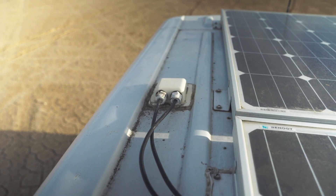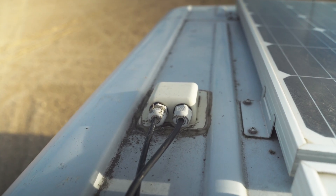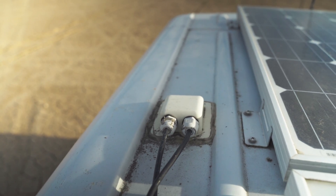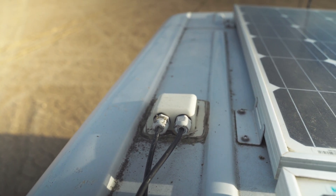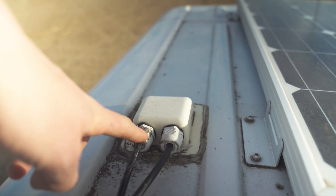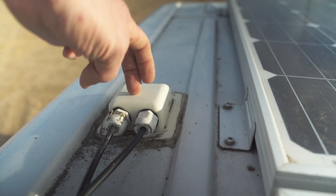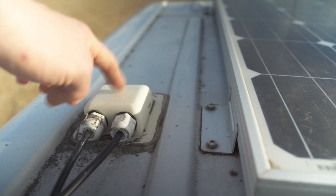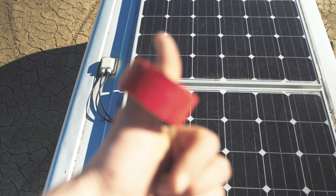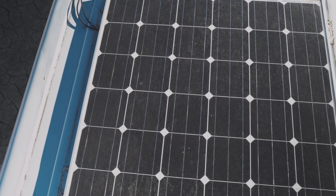There's a positive and negative wire that comes from the solar panels, and to get them to go inside the van I used what's called a through-hole cover. It's basically what they use on sailboats when they want to bring lines and power inside. These things tighten down and seal around the wires, then go in like an L shape through a larger hole I drilled out. I stuck the through-hole cover down with really strong 3M tape and then used lap sealant as an extra precaution.